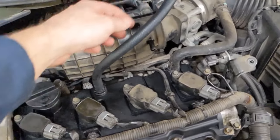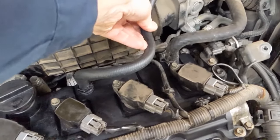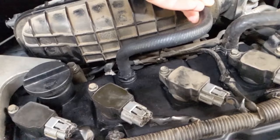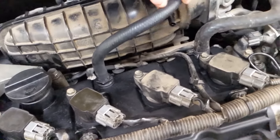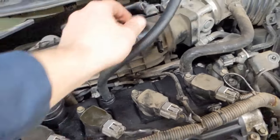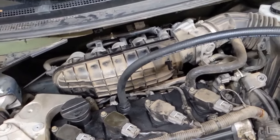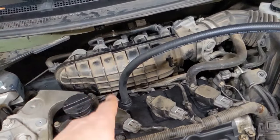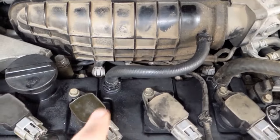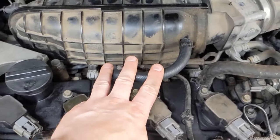Here's the hose — I just bought it long. Put it on your PCV nipple there and cut it to the size you need. It won't look exactly like factory but it'll work just fine. Cut it there, put it on, you're done. When you buy hose, it's important that the hose is made for this kind of harsh environment — coolant hose may not be enough. And there we are with the clamps on. After a few heat cycles, this will eventually conform to shape.